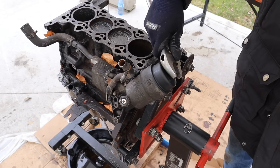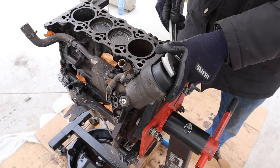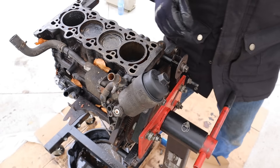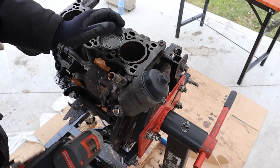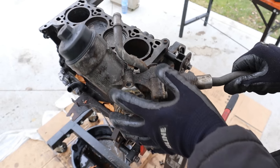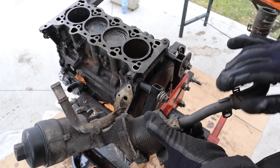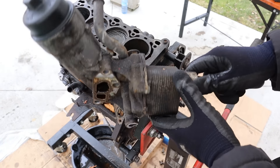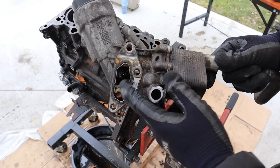The oil filter uses a cartridge style design which I don't really like. I'll go ahead and remove it. Yeah, stupid plastic housing. Next up I'm going to remove this oil filter housing — sometimes it needs some encouragement. So you can see that the oil filter and the cooler are all in one assembly. Basically you've got coolant coming in and going out there, exchanging its warmth with the oil over here, which also has an inlet and outlet.